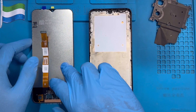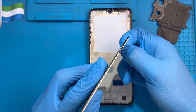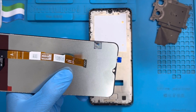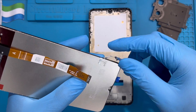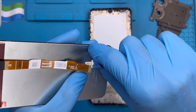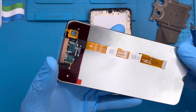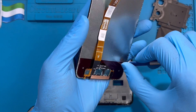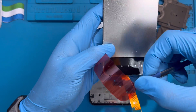After you put the glue down on the phone, now you need to fix the new LCD. Make sure you take out the plastic here in front of the camera so the camera will be more clear. Then remove the warranty sticker so the LCD can rest properly. Remove the plastic down here very carefully so you don't damage the connector. Very slowly. Use the connector and just take this one out.